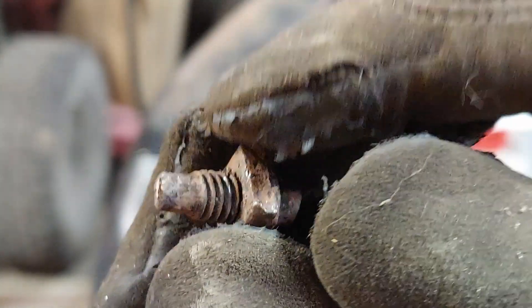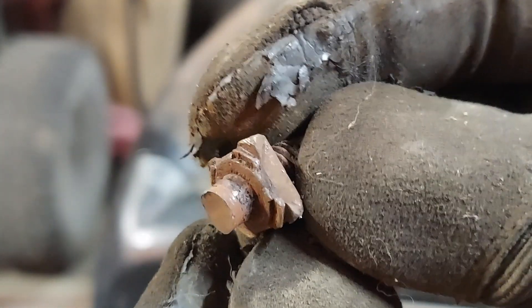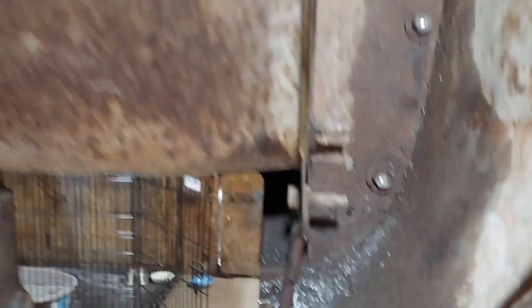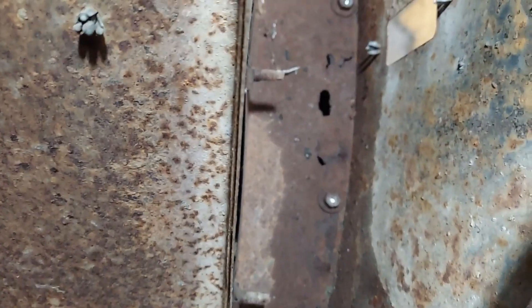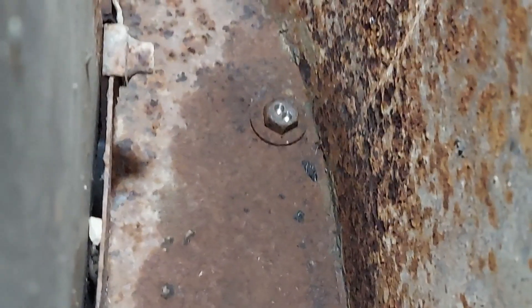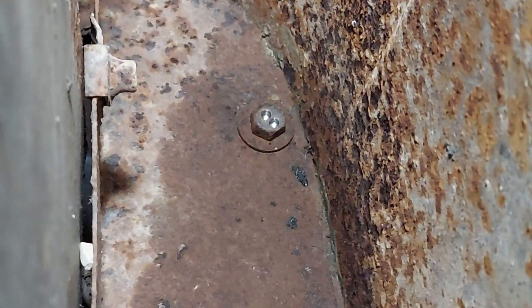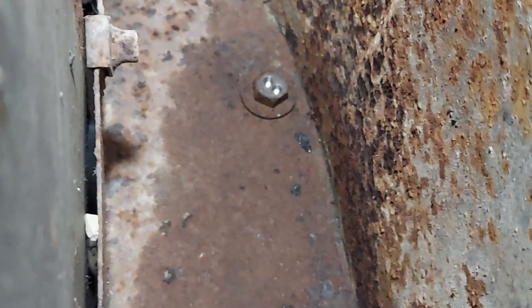As you can see, the threads really aren't that rusty — it's just these tack welds or whatever that hold that little square nut in, and they just don't hold up. My attempt at getting the passenger side out: I managed to get the bottom three fairly well centered, but the top one went off course just like the other side. I decided to go ahead and drill two holes in it just to get some of the meat out of that bolt head and make it easier once I hit it with the die grinder.